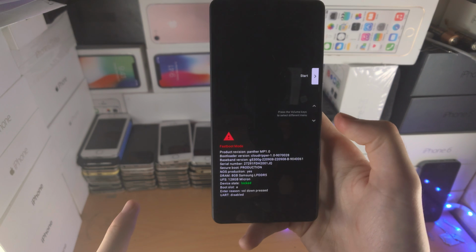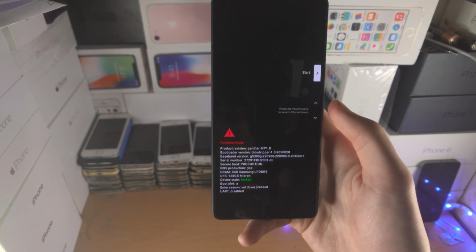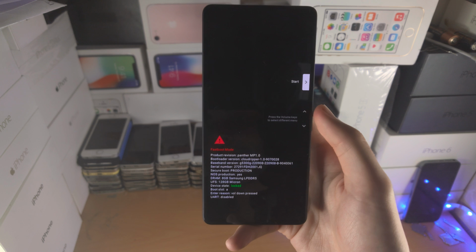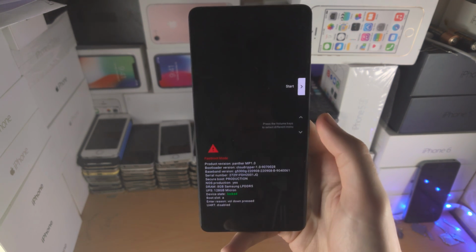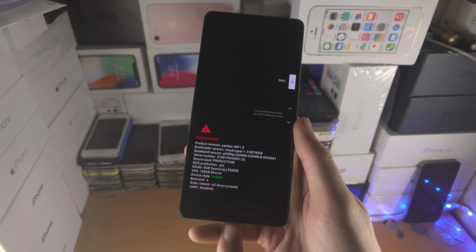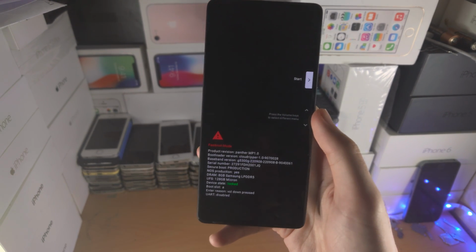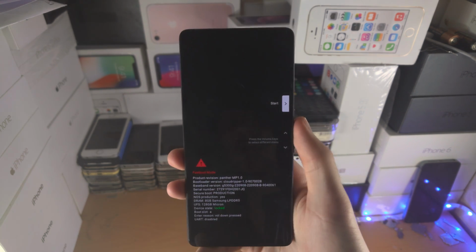If you had issues doing this, just make sure you press and hold the power volume up, power volume down keys for the exact amount of time, which I do. That's why I say, watch the video while you are doing it at the same time. In the future, Android may make it so fastboot mode can only be accessible by connecting your Google Pixel 7 to the computer. So if you give this 10 attempts and you still have issues, just connect the Pixel 7 to the computer, not to the charger, just the computer, and then that should solve the issue.